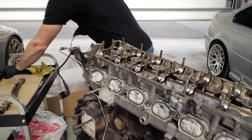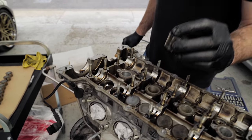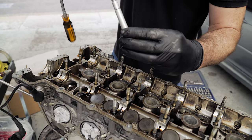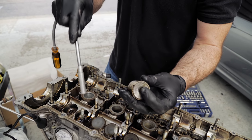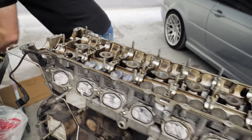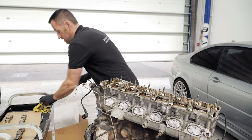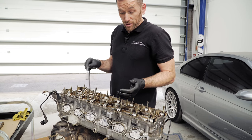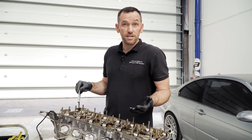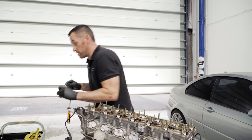And then, obviously, you're now getting the valve buckets, with the shims on top. That's where the clearance is set. These little shims pop out. That's how you adjust your valve clearance from the cam to the top of the valve. So they will come out to get the head out, and then the valve clearances are something that we'll do when we put the engine back together. When it's rebuilt, there will be a difference in the clearance from where it's set now. The backs of the valves will be cleaned, there'll be no carbon there, so it will actually close up a little bit. So we'll just reset them as it goes together.